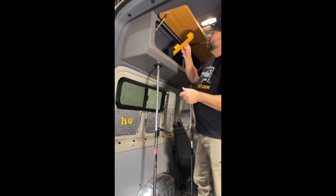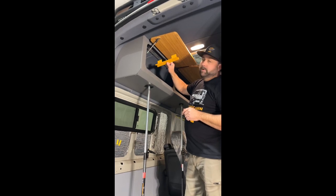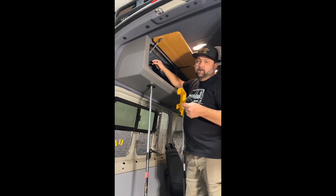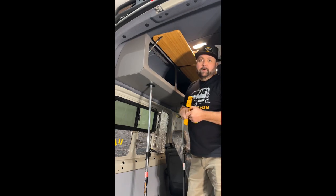This bracket gives us a place to bolt using an existing rivnut and makes up the air gap in the headliner for the cabinet. The top holes we don't need to drill just yet — those go in when the headliner is removed and get installed on the actual factory roof beam, giving us a nice fresh clean area to install our rivnuts and mount the top of the cabinet. So we're going to go ahead and mark right now, and then begin pulling the headliner out.